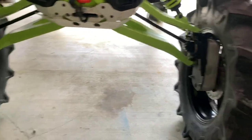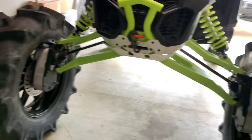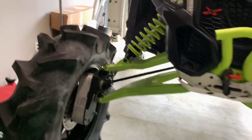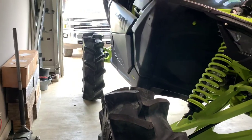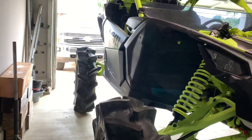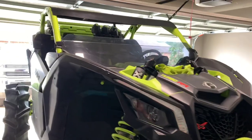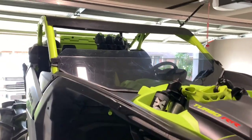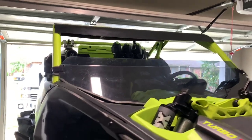For portals, I'm running the cast 8-inch 45% gear reduction portals from Super ATV. So far they've been good. I had one portal seal leak on the passenger rear — I think it was due to running fast on some trails — but besides that they've been good. I've been mindful of them when I get in a bind, trying to keep them from breaking out of their gears.